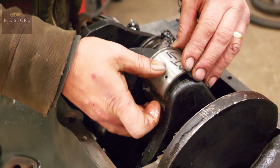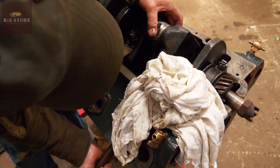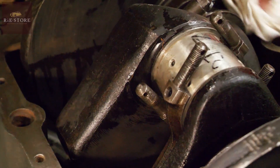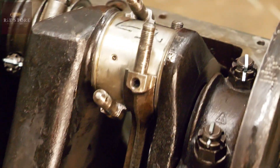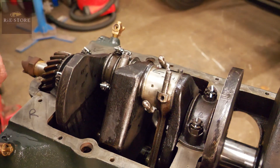So that's another two bearing bottom forwards, that goes that way. Make sure you're not catching the lip on the edge of the bearing. So that's the top side. You're tapping that into a particular position — yeah, it just sits on the bearing and you put your caps on, tighten them down onto there, check your rotation again.